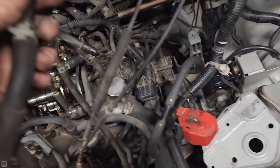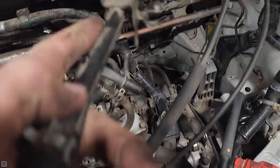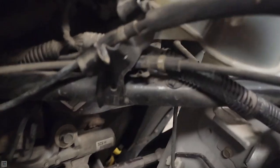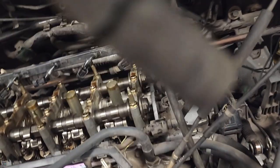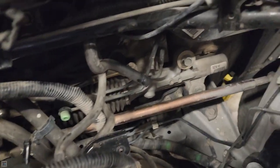Just to give you guys an update of what I'm doing here — there are these vacuum lines. This main thick one down here goes from the intake manifold, runs through this hard line, comes up here, does a 90, and then goes to the brake booster. I've removed that one. This one here goes to the throttle body, and this one is acting as a vapor line — or a breather valve — for the fuel tank. That one goes underneath the brake booster line, out here, goes into this hose, and then from that hose it goes underneath this metal piece and out this fitting here.